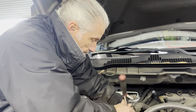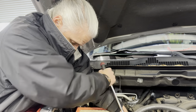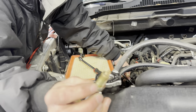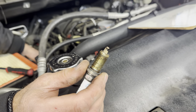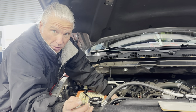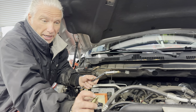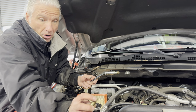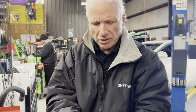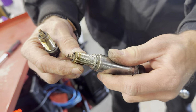It's always a good idea, when you're pulling these, don't just pull them out and throw them on the bench — take a look at them, because it's a good way to tell how the engine's running. That one's pretty clean. If you see a bunch of white, ashy buildup on it, that could be oil — the engine's using oil. If it's all black and nasty and coated, that could be running rich, too much fuel. If it's extremely white and really clean, that could be running lean, or even possibly some coolant leaking into the cylinder.